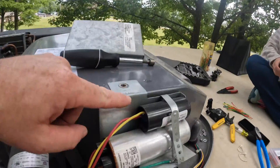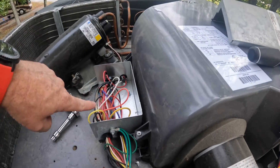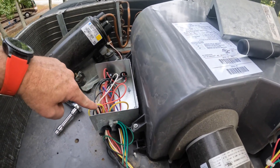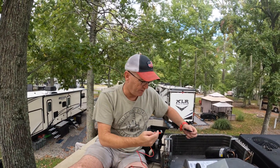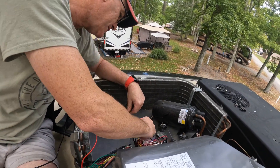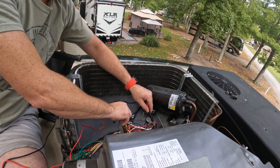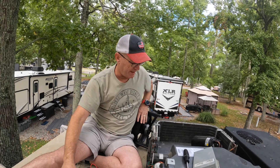Normally there are terminals on these, but these are what they call sealed capacitors, so I'm going to have to do everything on the board to de-energize those. It's really simple — the start capacitor is going to be a yellow wire. We're going to connect to the yellow and then to the red, and that is now de-energized.